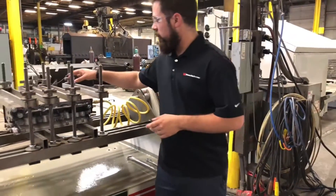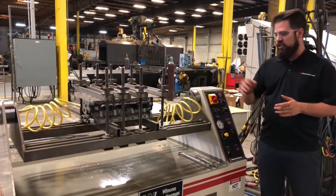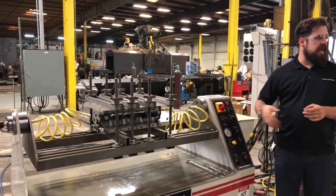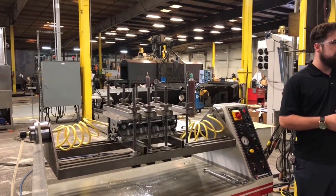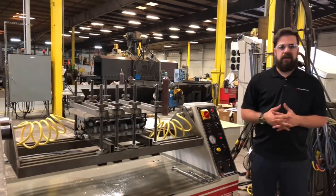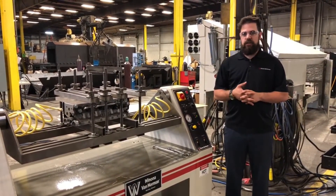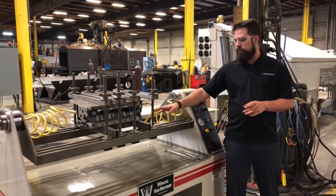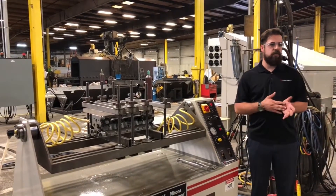The pump is pneumatic so it will automatically stop when it reaches maximum pressure. Obviously we don't have any major leaks — we'd have water spraying everywhere. I am at 220 degrees. During testing the proper thing to do is to bring the head up to pressure and let the water flow through the head for a bit. We do this to bring the head up to operating temperature of the engine, to help simulate actual operation and expose any micro-fracturing inside the engine that could be causing leaks.